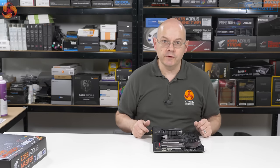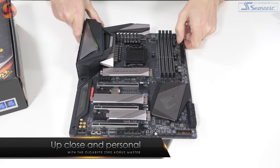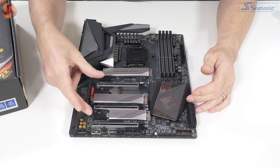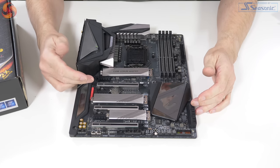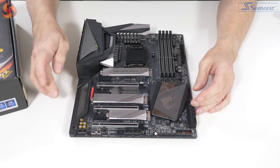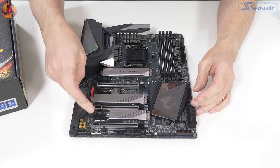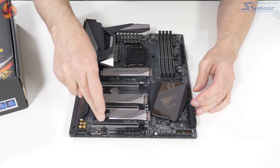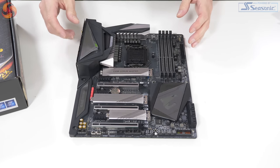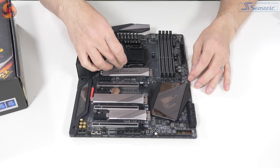The layout is quite conventional for an enthusiast motherboard. We've got three PCI Express slots for graphics cards, though that's not entirely accurate: the top slot is x16, but if you populate both it becomes x8/x8. That third slot is actually x4, and if you install a PCI Express SSD in one of these slots it'll suddenly become x2. So on the face of it you can install triple RTX 2080s, but you can't — and you wouldn't want to.